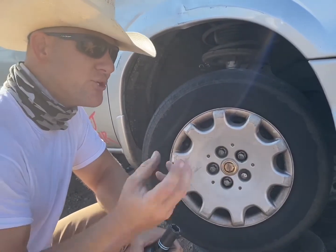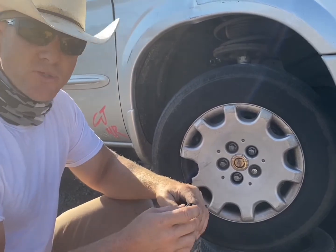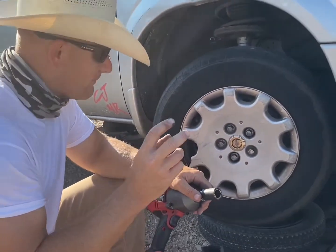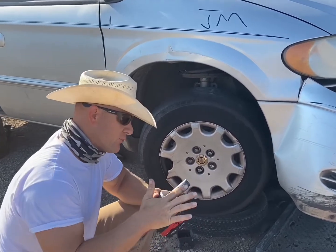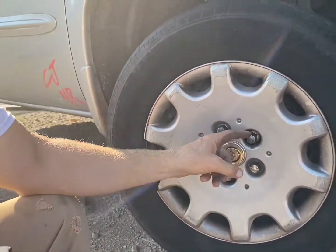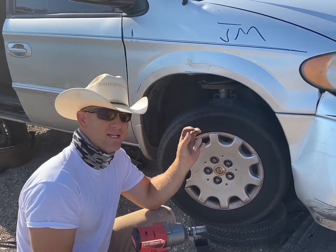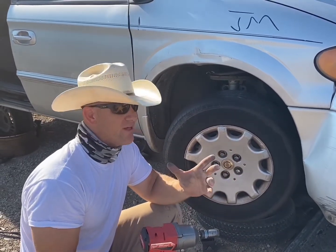Now, we know a traditional static socket, and I say static because there's no moving parts, okay? The Merrick Tool cam lock socket has moving jaws that locate each flat on the hex and grips it. It actually becomes one with the lug nut and transfers all of the energy, all of the impacts from the impact wrench through the tool directly through the lug nut to the threads on the fastener. It lubricates it with air because it's using the harmonic energy, the vibrations from the impact wrench, and it transfers that lubricity, the air, to the threads, and it actually unscrews faster and more efficiently than any traditional static socket.